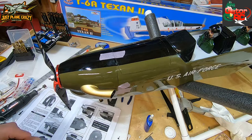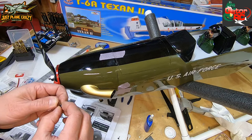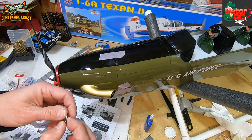And then what we're going to do is we're going to use some metric stainless and black washers for dress up in there. And then the option really becomes, do you want to use anti-vibration fuel tubing in those holes? Make them a little bit bigger than this. The fuel tubing, the silicone will slide in this and then that will go in there. So that way the cowl is never vibrating on the screw.